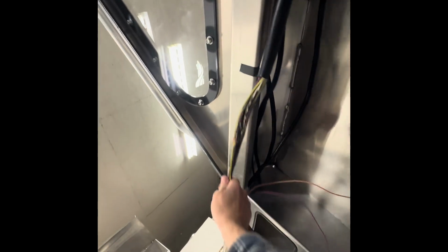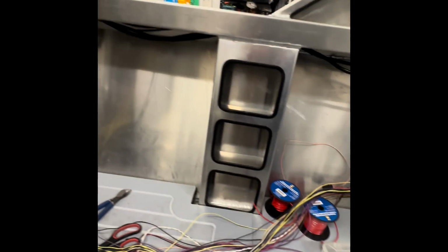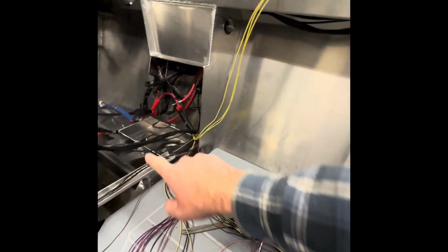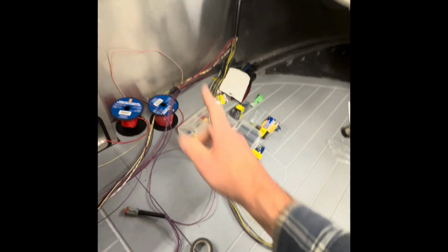What I'm going to do is tape it up to the side. There's a piece of tape right there. That's where the old joint was, where the fuel harness came down. I was just going to start there and run everything back. And I'm like, wait a minute, half the wires come from back here. So why not just take all that sheathing off and then figure out which ones I actually have to extend. So this way, I'm only extending, where am I? I'm only extending these right here. This little bundle. That's all I have to extend. And one for the fuel.